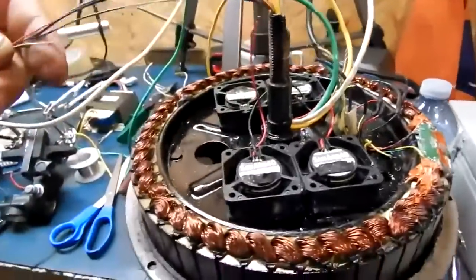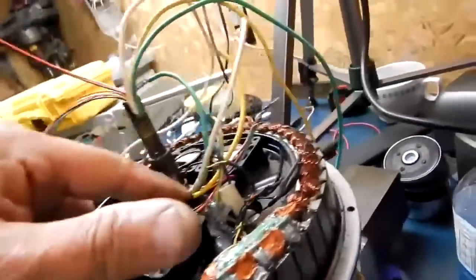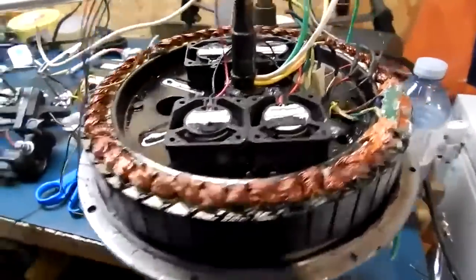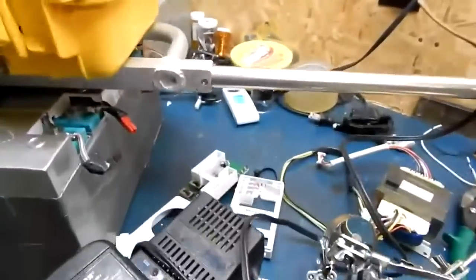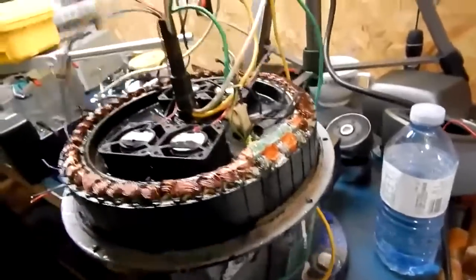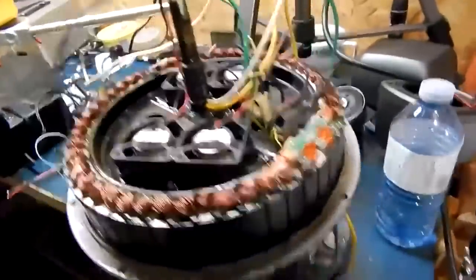I got one more wire down there — it is tight, but tight enough. I got the phase wires; I'll have to tube them up. There's your fan wire — put a connector on that. Phase wires are through, but it is tight. There's not gonna be enough room for a thermostat or a detector. So what I'm gonna do is just have it so when the bike turns on it runs off my regulator and these will just turn on automatically, because they're gonna get hot either way — this thing almost runs at 90 volts, and it's at 36 volts. We'll run it that way; these won't use much energy. The thermostat is out, unless I can find a way to put it on the outside of the casing — or drill a hole in the casing and have it sitting inside to get the ambient temperature. But there's gonna be holes all the way around it, so heat isn't really gonna build up inside. This is just gonna help shoot air out the holes. We'll just have them run constantly.